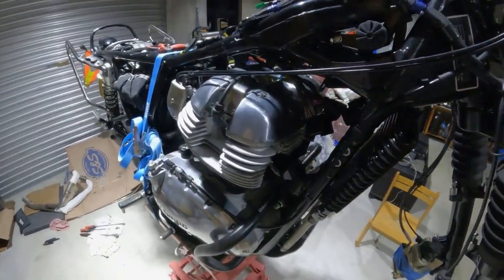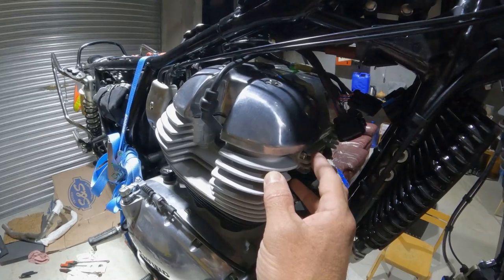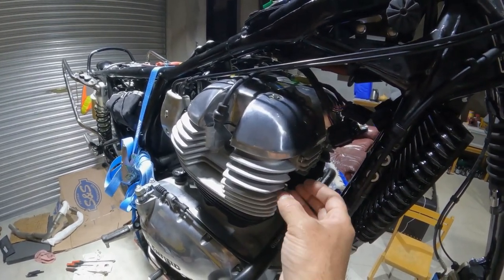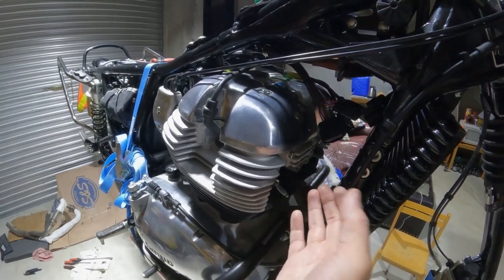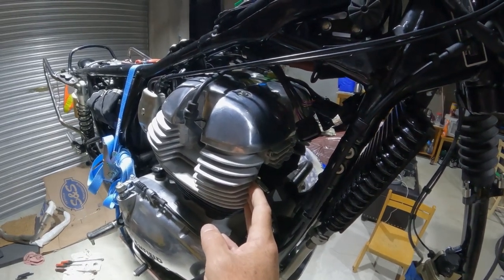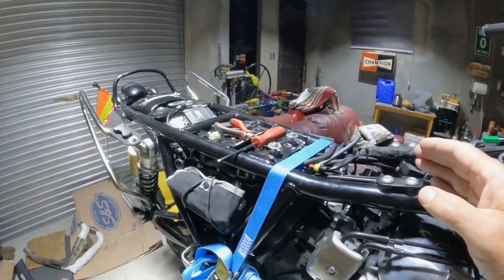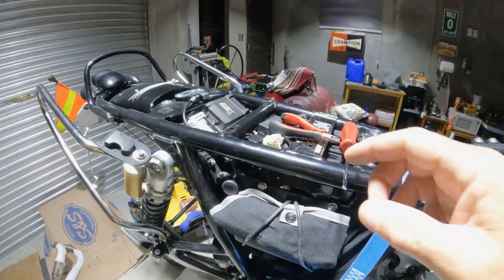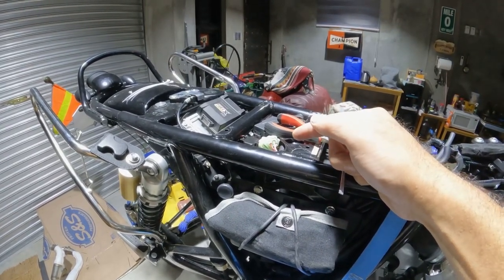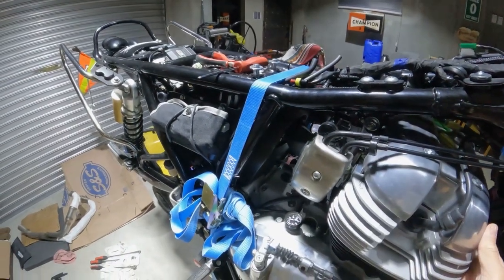What was normally here is an ugly air injection line from the air box that injects air into the exhaust right before the header — for emissions of course. We're dealing with a 650 twin, so I'm not too concerned about extra pollution from this bike. It had a manifold and a thick hose that ran all the way back to the air box, with a solenoid that turns it on and off. The kit provided a blanking cap for the solenoid port so the OEM ECU will think it's still there.